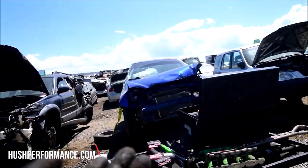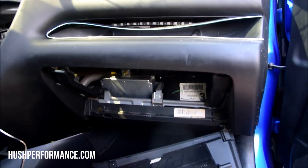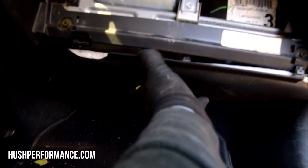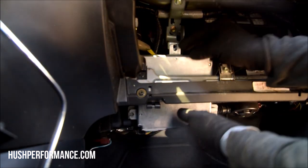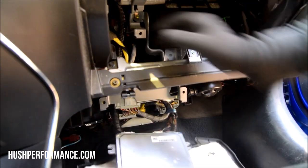Since we're not taking the engine, I just finished unplugging everything from the block - the wiring harness - and now we're going to pull it off the ECU. This particular wiring harness, just like the RSX, gets attached to the engine and then comes completely inside the firewall right to the ECU. On the EP3, the ECU sits right behind the glove box. This kick panel right here underneath comes off and exposes the rest of the ECU.